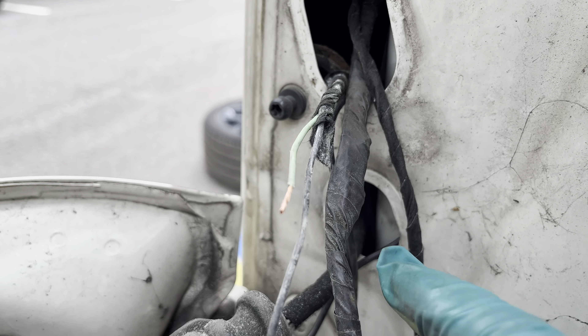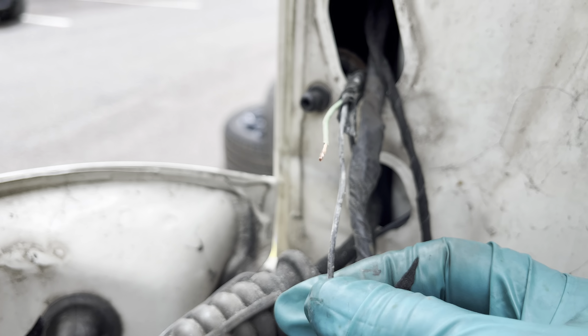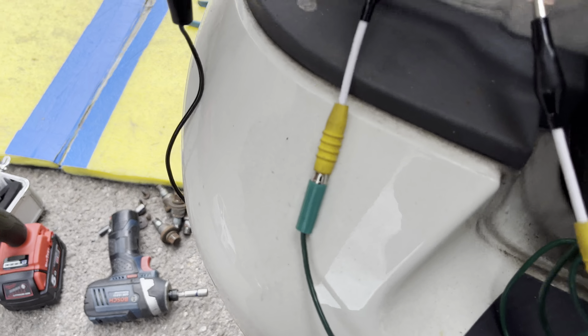That in the back there is the rubber grommet, and these are the two wires coming from the sensor. The green one was completely corroded away — rotted away — and the other end is there. That was the fault.